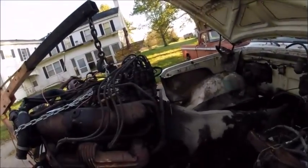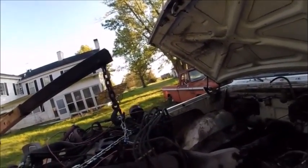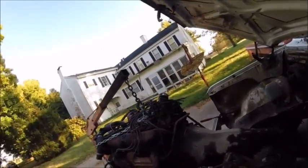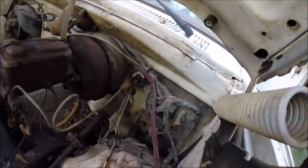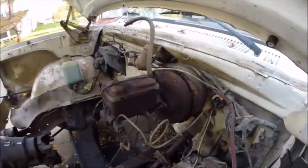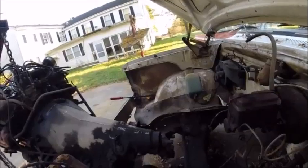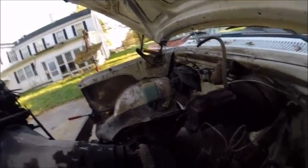So shut it off, and antifreeze everywhere all under the hood, and had to call one of my buddies to come get me on the side of the road. Had to recover the truck and trailer, and the ignition module down there has got goo running out of it. So apparently all the antifreeze shorted it out, killed it. So this has hastened the Cummins conversion. Basically it was the last straw. Not putting a radiator hose on it, just gonna put a motor in it.